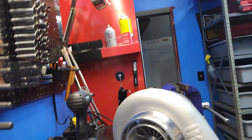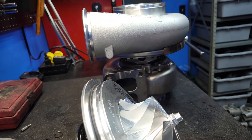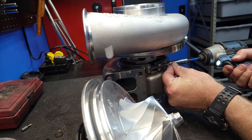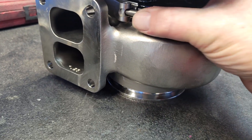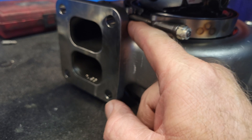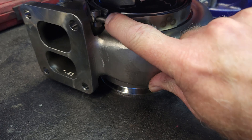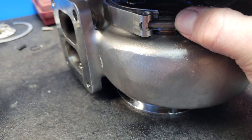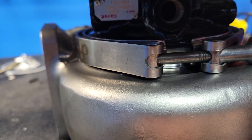I'm going to loosen this guy up for you. Get the clamp loose. This is our window of rotation for this guy. If we go towards the flange and the foot — you're going to have a bolt here so it's probably going to be a little tight — but that clamp will only rotate to that point, then it hits the housing. Going away from the bolt, it is up against the housing right there on this side. What this will do is cause this clamp not to apply torque evenly to that V-band flange.